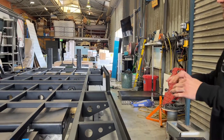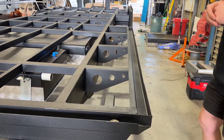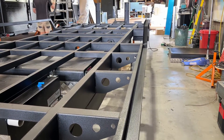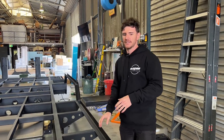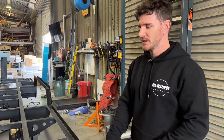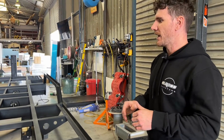There are a few key changes to our new Gen 2 Elros chassis. One of the most noticeable is we've forgone the angled cutaway back, so that's no longer a feature on the chassis. Probably the second most notable difference is we've in-house developed our own C-section exterior perimeter on the chassis, and this will now be used to integrate our EPS panel into the actual chassis itself.